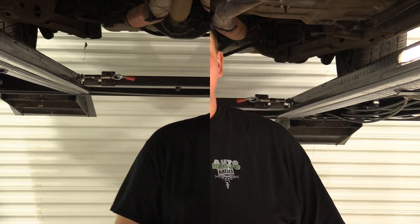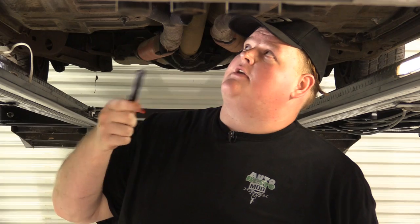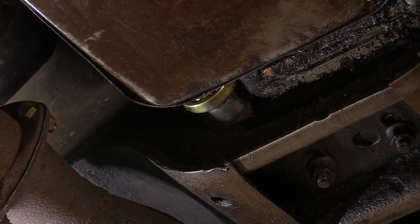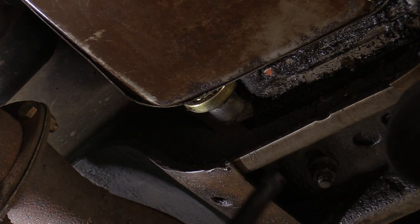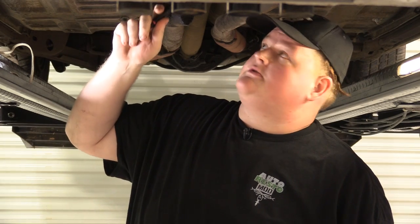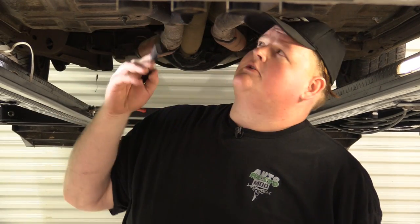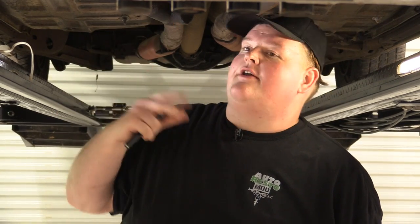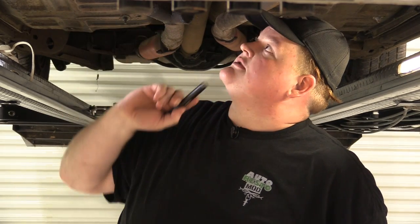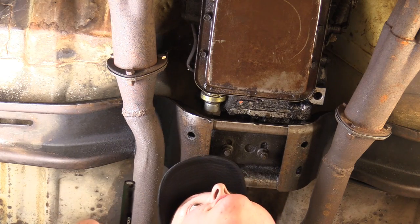The improper shifter setup may mean it's not shifting where it's supposed to. We don't know if that's our issue, but we'll keep moving. The next thing to look at is the modulator valve — this isn't exactly going to create our problem with not shifting out of third, but it will affect shift points, shift firmness, and overall drivability. This one is a dual vacuum line, I believe a red stripe, used primarily for vehicles equipped with EGR. You can get adjustable ones with different color stripes, each having different characteristics. The adjustable modulator is probably the best option if you like tuning your car.